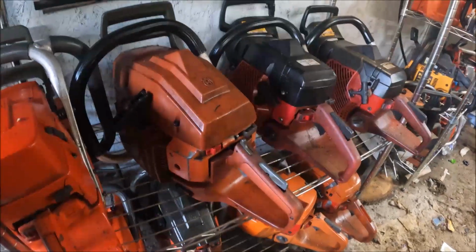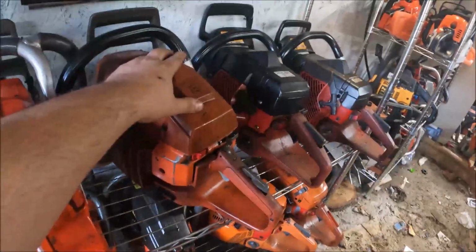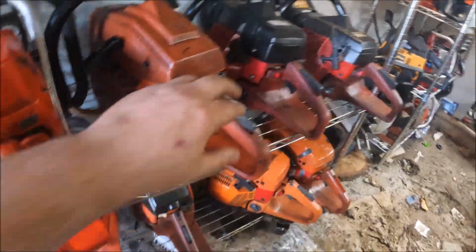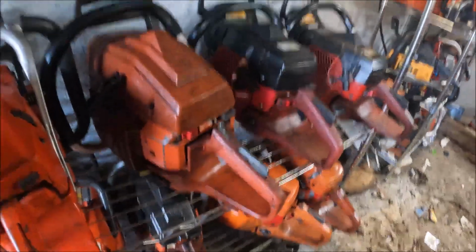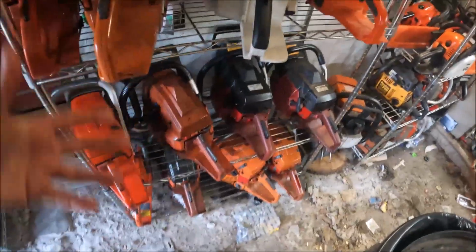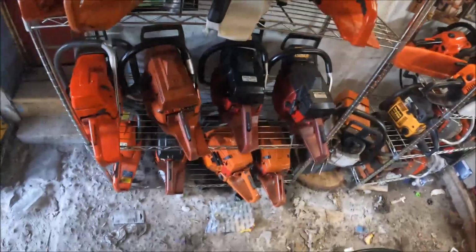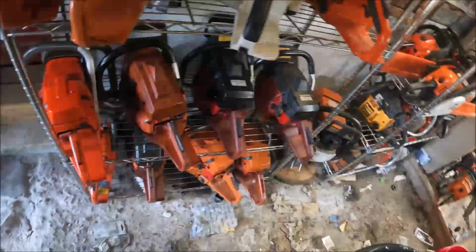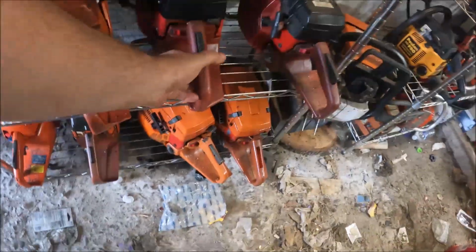I do have another OE 288 cylinder here I think's repairable. I'm probably going to get out and go through it and get that back on it to make more of a work saw out of it. Not to say it ain't a good work saw now, but it's just a little too high strung and a little zippy. The cylinder that's on it had some damage to the exhaust port, and I had to raise the crap out of the exhaust roof to fix it. So, you know, it is what it is, and it still had some scratches and stuff in it I didn't like, but at the end of the day, it is a good running saw, though.